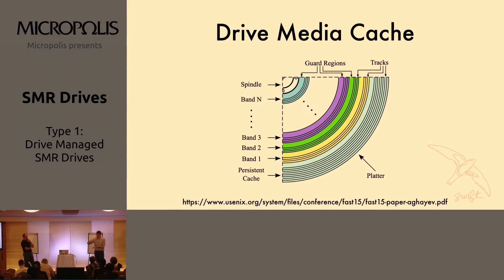You've got about 30 gigabytes reserved on the overall drive capacity as this media cache. The drive has to manage two things about the cache: first, how many bytes are actually stored — if it gets too full, things need to slow down because the buffer is filling up and we can't offload writes to the SMR zones fast enough. The other thing it has to track is basically the number of writes, which is something else that can impact performance.